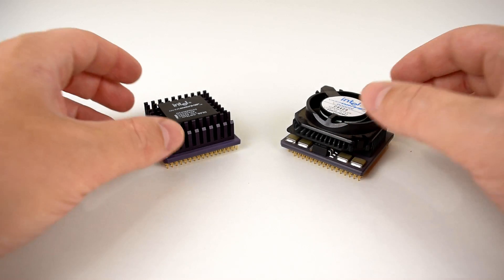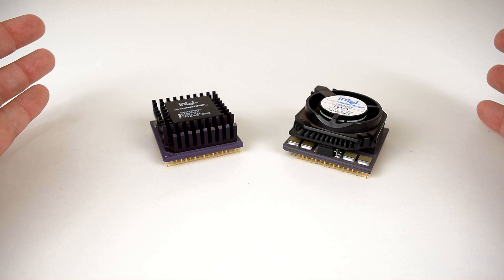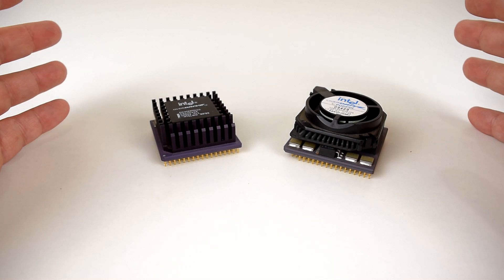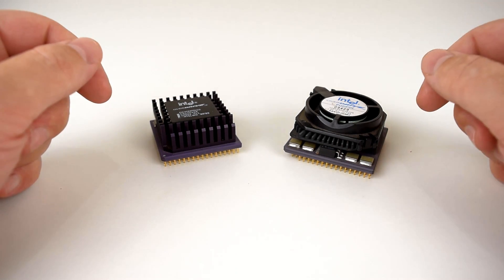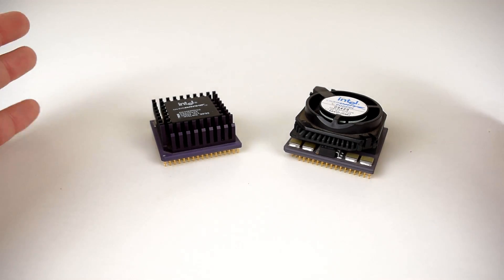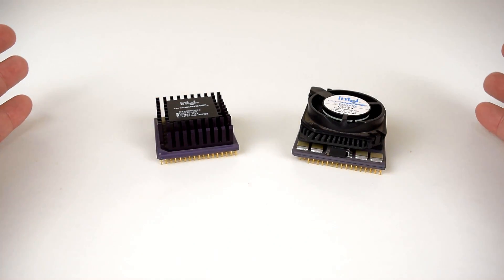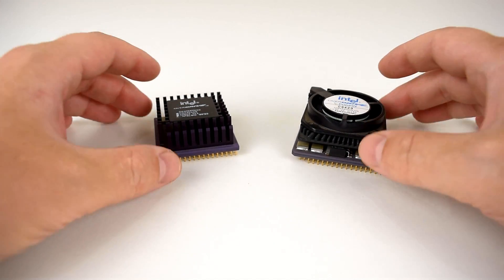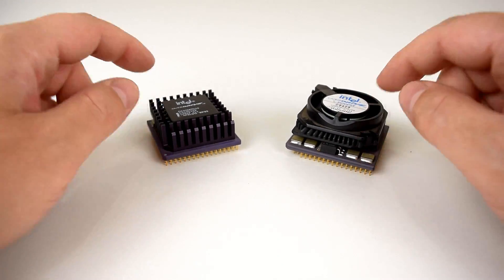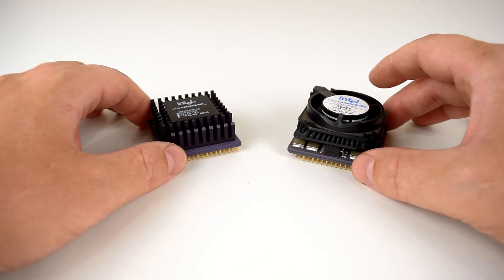There's circuitry around here, the voltage regulator, and it's got its own little passive cooler. These are drop-in chips that should work with most 486 motherboards. One little issue I had was with the cache — the motherboard has 256 kilobytes of cache which worked with the DX33 and DX2 66, however on these two chips the machine would not boot; it would hang straight after the memory test. Configuring the motherboard for 128 kilobytes of cache, these chips did suddenly work, so I completed all benchmarks with 128 kilobytes of cache.